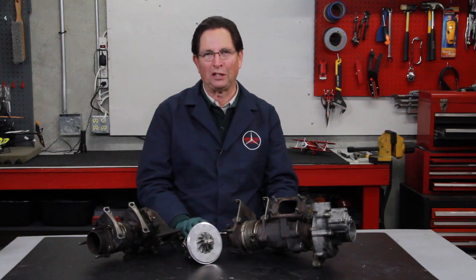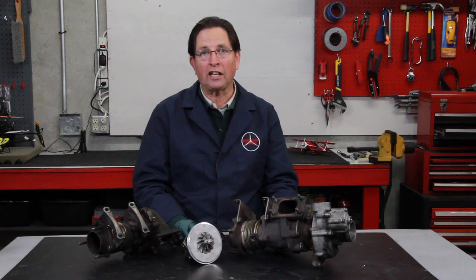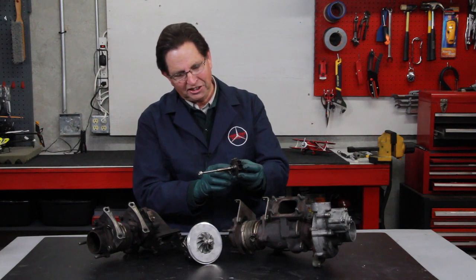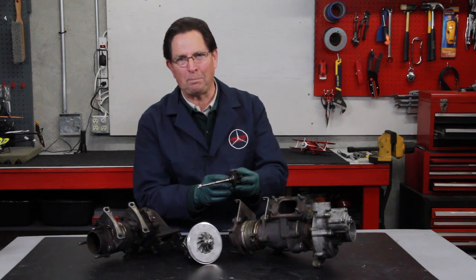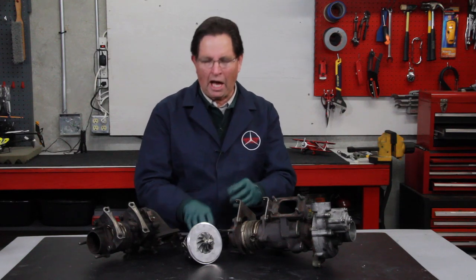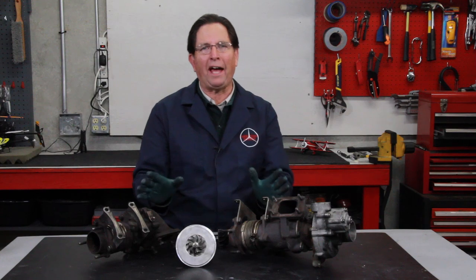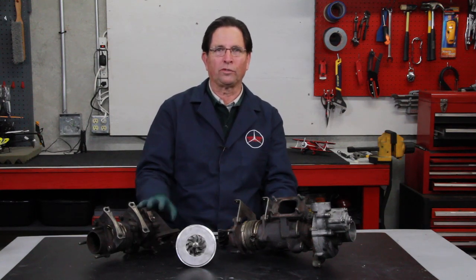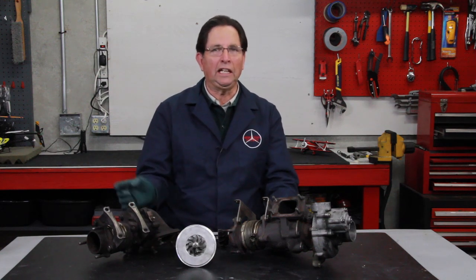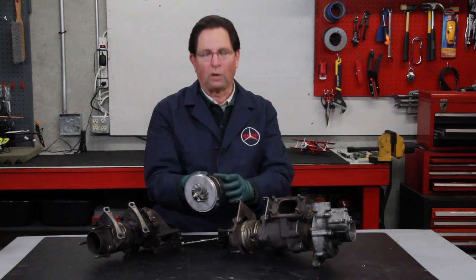There was one thing I found really interesting on this 603 turbo. This is one I bought used and when we opened it up we found a lot of rust inside the aft section, or the hot section of the turbo. When I pulled the turbine wheel and shaft out, this area right behind the sealing ring was heavily pitted — deep pits of corrosion. There was also a lot of severe pitting on the back section of this housing, so somehow water was getting in there. I suspect the 603 engines are known for a weakness in the cylinder head — the heads can crack at some of the journals — and it could have been leaking coolant, a very slow leak, into the exhaust ports. That coolant or steam was then getting into the turbine section of the turbocharger and over time caused a lot of corrosion.